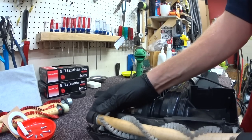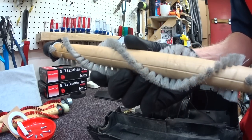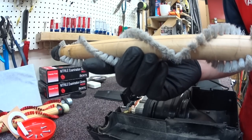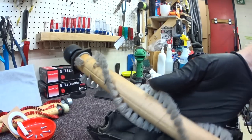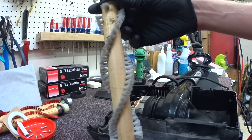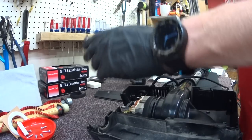This Oreck has a brush roller. Not only is there stuff melted on here, but this brush roller is white — these were part of a Microban brush roller system. These had real soft bristles that fell out and were just not made right. Anytime you see white bristles like this on an Oreck, Oreck says you should replace the brush roller.